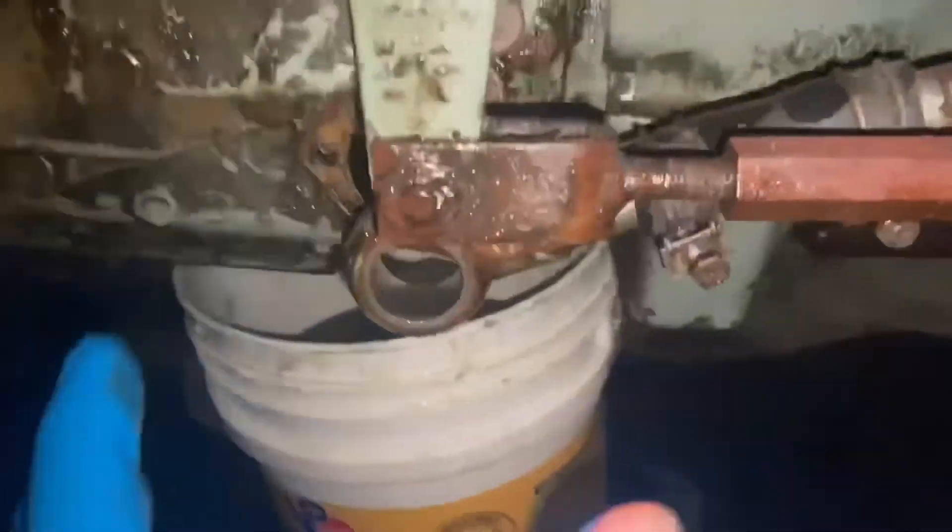In the next couple of video clips, we have found our main problem. The filter was put in here backwards — it's kind of a big deal, so the flow was really, really being restricted. That was the entire problem. The filter was in there backwards. You have one end of the filter that's open, and the other end is more or less closed with a screened end. With the filter in there backwards, the pump just cannot get enough fluid. Unfortunately the filter had also seen better days — it had been torn and ripped apart from years of use and abuse. It's a mesh filter, so we ended up having to buy a new one.